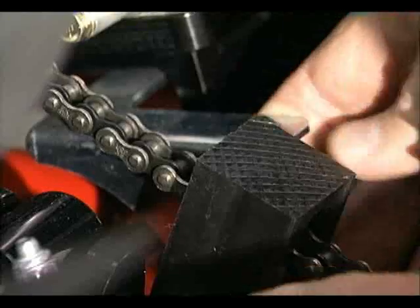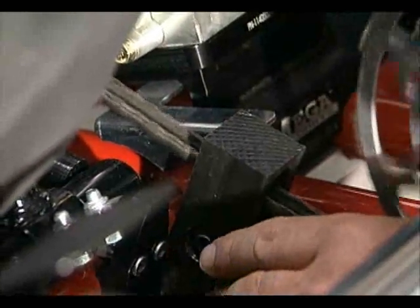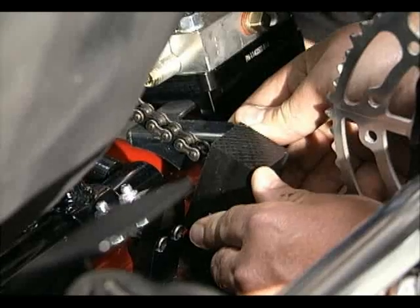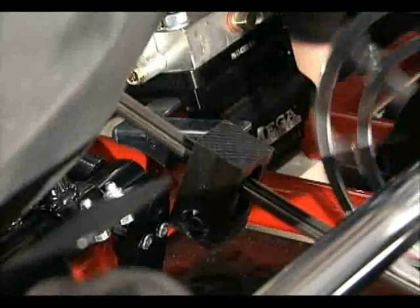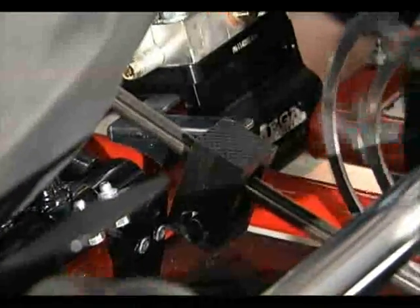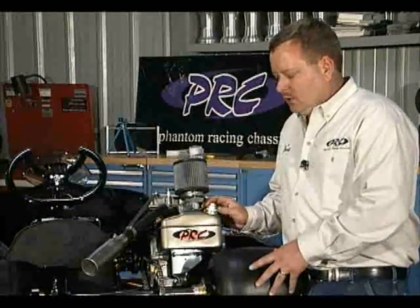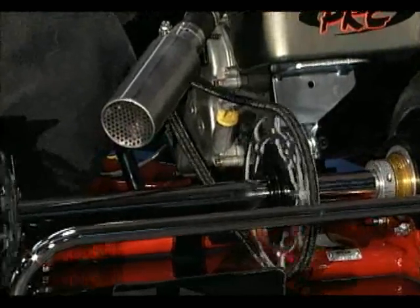The block is now parallel to the frame, which is parallel to the chain. We spin it — nothing is hitting, no noise whatsoever, it spins free. After you run it a time or two, you may want to double-check to make sure everything's still in place. Usually after you go back and check it the first couple of times, it shouldn't move and shouldn't have any problem. When placing your motor on your cart and choosing your chain link, try to keep the block of your chain guide approximately two inches from your rear gear — this keeps the block close enough to prevent the chain from coming off, but allows enough clearance so the gear will not hit the block itself.